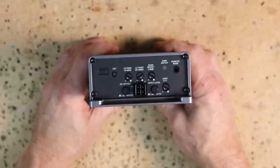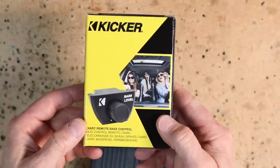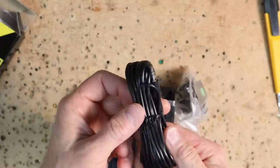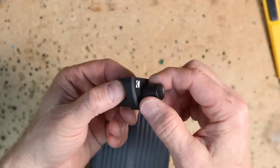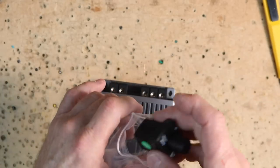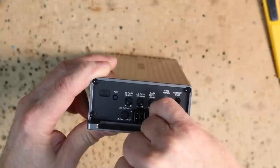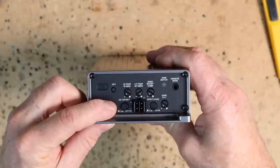For something this small there is a lot going on. In this top corner is the bass knob input — for this amp, if you would like one, you need the CXARC remote bass knob controller. It's an eighth-inch headphone jack style bass knob; the cable is about 18-20 feet long — super long. The bass knob itself is designed to mount with two screws, or you can pull the knob off, disassemble it, and flush-mount it somewhere. Gain controls between 0 and 11 volts. Next to that is your high-level/low-level switch — when pressed in is high level, which we will be doing. DC offset on and off — we need to test for that, as this is what we use to turn the amplifier on instead of remote turn-on.